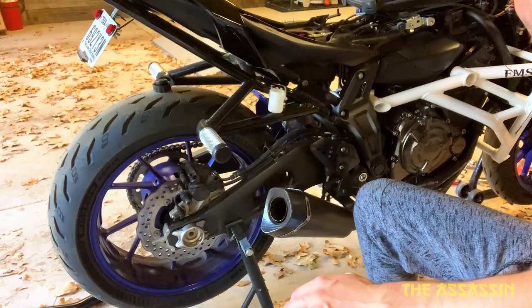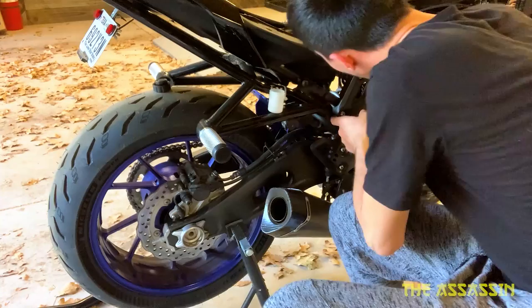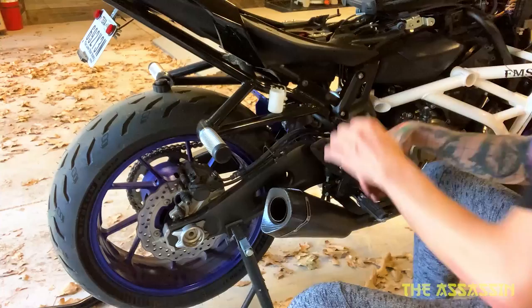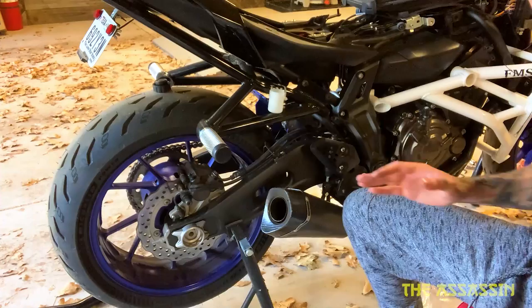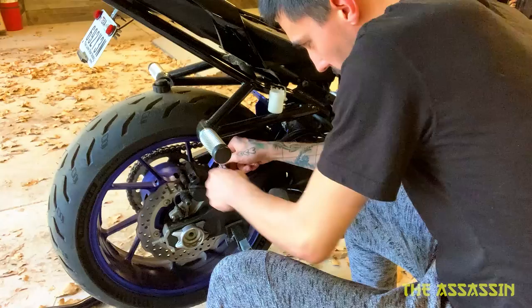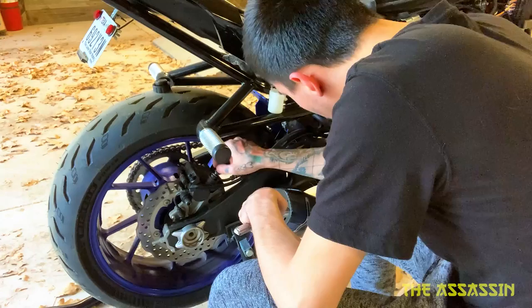I'll have to take off these ABS lines that run right here — probably take this panel off so I can see the master. I'll fish these lines out since I won't need them with the front ABS lines gone. Let me disconnect this — I think that's a 12 millimeter. That was actually not cranked on there at all. Alright, let's see if we can get this rear caliper off.